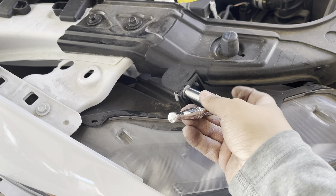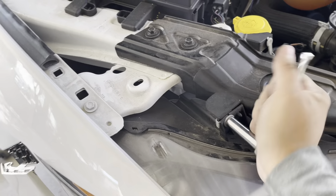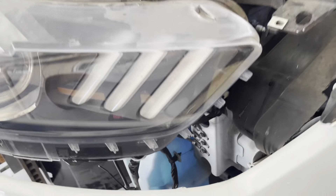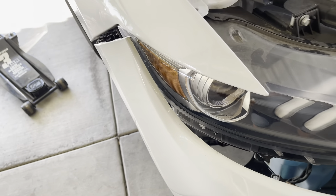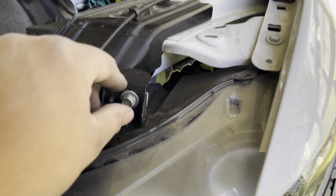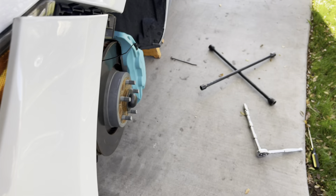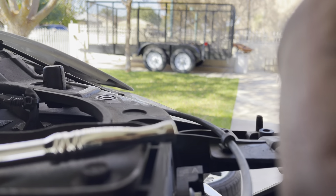I don't have the electric wrench right now because I think Reese took it and he's at work. I'll just loosen them up real quick and then take them off. To remove this bolt and that one right there you're gonna need a 10mm, and then the side one is actually gonna be a 13mm. Let me just mount the camera real quick.